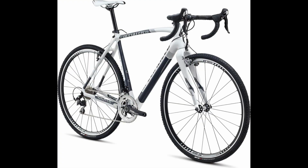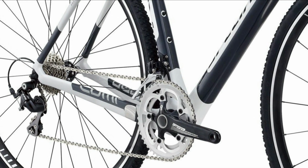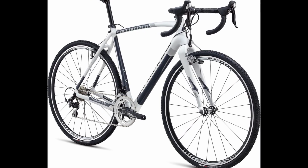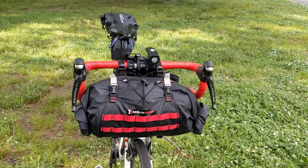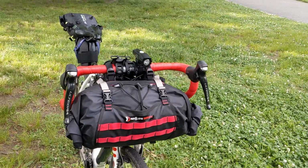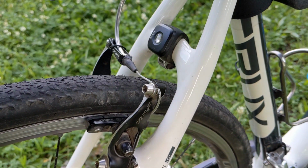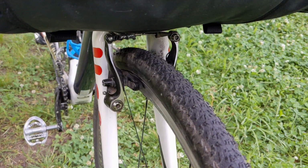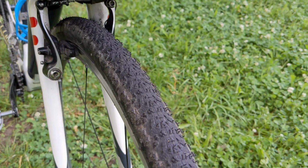Here's how the bike came originally. Check out this little chain catcher on the front derailleur. The bike originally came with Shimano 105 components, a FSA BB30 crankset and DT Swiss wheels. The previous owner upgraded mine to Ultegra components including the wheel set, and a BB30 to Shimano bottom bracket converter. The first thing I did was replace the stock cantilever brakes with TRP Mini V brakes. I find them so much stronger and their cable pull ratios easily match the road style integrated shifters.